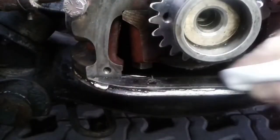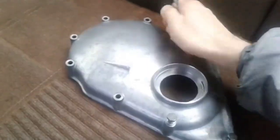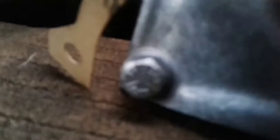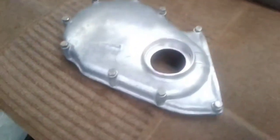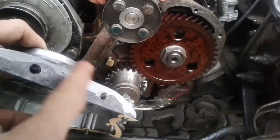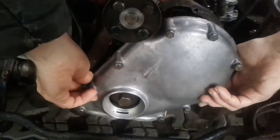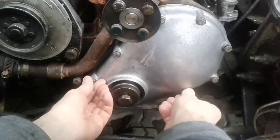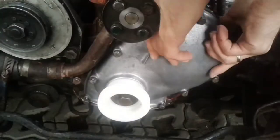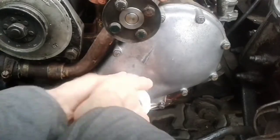I washed the screws and need to clean and degrease the gasket surface thoroughly. As you can see, these bolts are different. The cover will not spoil the seat because it is absolutely clean. This is the 4-cylinder engine gasket. Put the attaching bolts through the cover and slip the gasket over the bolts. When the cover is absolutely clean and free of oil film, use a tenacious gasket compound on reassembly. Fit the cover to the cylinder block and do up the bolts finger tight. Align the cover so that the crankshaft hub is perfectly central in it. Carefully center the cover using a special tool to ensure that the distance between the cover and the hub is the same all the way around.